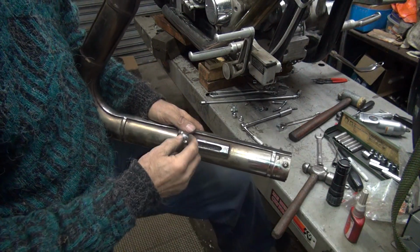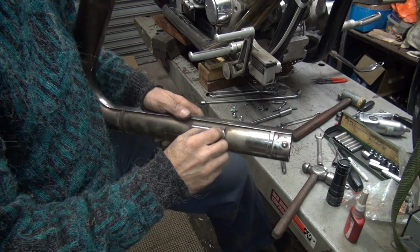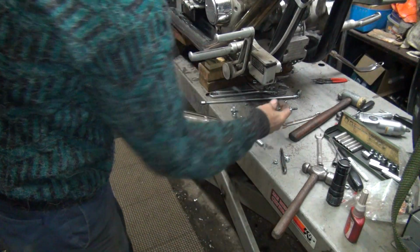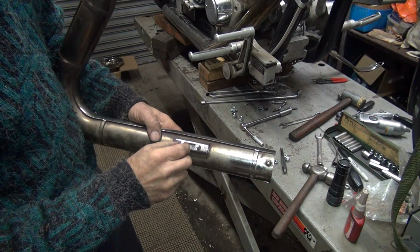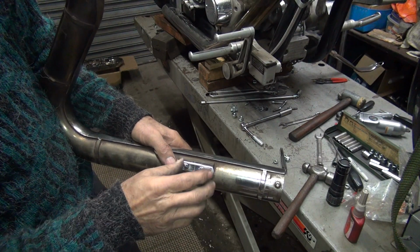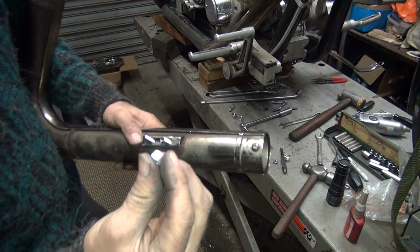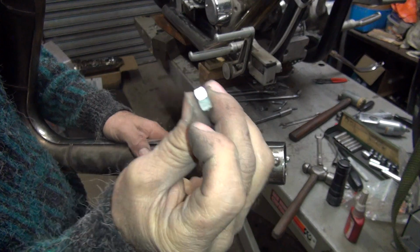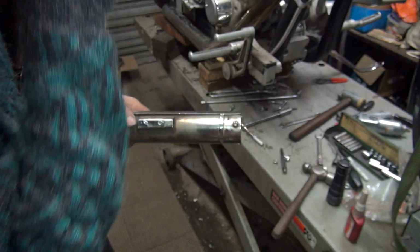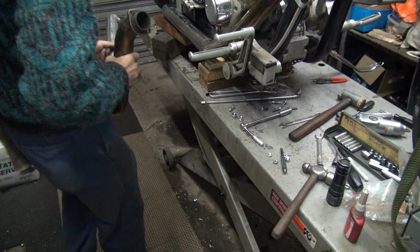It didn't hurt to really use the real thing when you're doing this. There you go. This looks real nice. Okay. Other one. Goes right in next to it, no problem. Okay, so these are ready to go back in now. I went and got me some mechanical locking nuts, so they got a little pinch area right there where that little mark is. Pinches the threads a little bit and tightens the nut up. So it's mechanical locking. Okay.